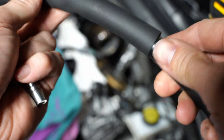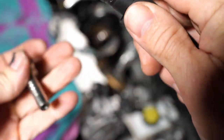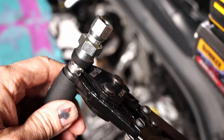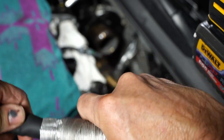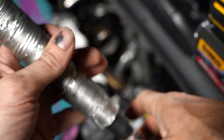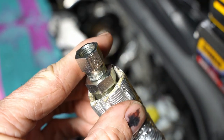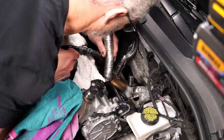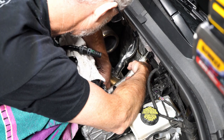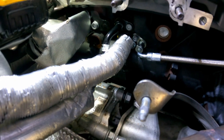This is the factory heat shield - there's a rubber piece that goes over and then the aluminum heat shield. I'm going to use this fitting I bought to adapt this hose to an AN style fitting, giving me my block side coolant return connected to the new turbo AN fitting coolant pipe. I'm told it's not uncommon to have an issue with that billet piece fitting in the block. I did change out the O-ring on the factory one using O-rings from my turbo install kit, lubricating with oil. So instead of a fancy braided line, I have the factory hose and heat shield adapted to fit the turbo pipe.